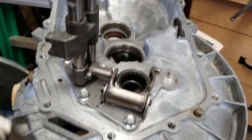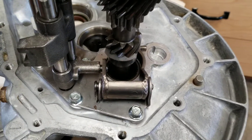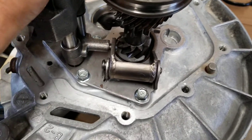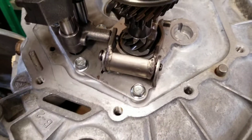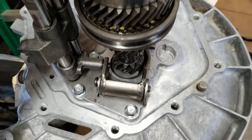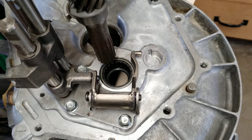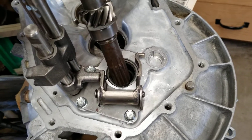But in the meantime, we got this thing. So what that little flange — or that spacer, that little washer — is for, is whenever you put this together, this just bottoms out in there. This is basically just for assembly. We would have the two gear stacks in here, one side by side. And then that washer — if you notice — we had to change that front bearing because this is a roller bearing in this transmission. It's a newer design. That's what that collar's for.